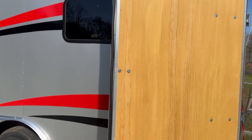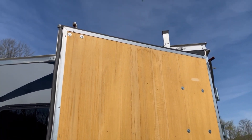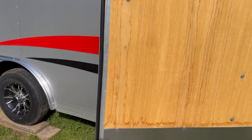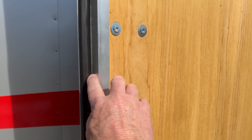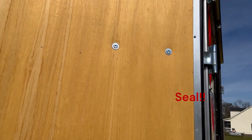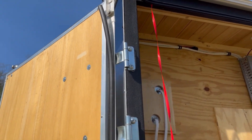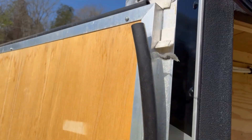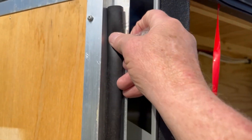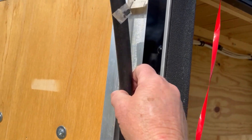Many of you who have been building cargo trailers may have experienced this. I happen to have barn doors, but I'd be willing to bet even the drop-down ramp door. You may be able to see the water staining going down here, and you can particularly see it here at the bottom. While they do put an adhesive — it's about a half-inch rubber trim on it — they don't really put a lot of effort into sealing. You can see on this corner that they cut it off two inches short of the edge. This one, two inches short.